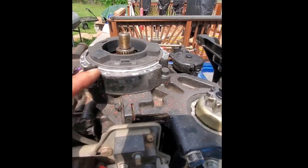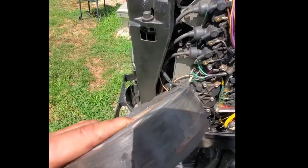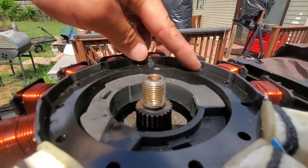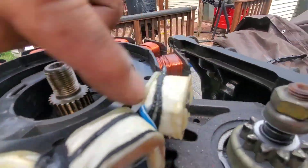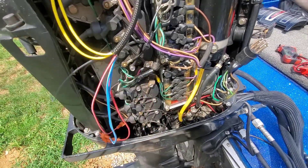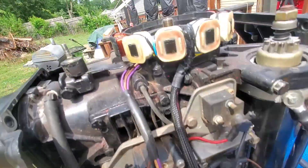Let's get the new stator in there. Now I've got the new stator in place, and the positioning is important — the harness needs to be facing the switchboxes, right above them, and then you need to line it up with the holes. I was actually able to find another stator screw in my inventory. I'll put some thread locker on them and lock this down as tight as I can, because I don't want it to slide and disconnect again and cause a bunch of headaches. Then we're going to connect the two yellow wires — these go to your rectifier to charge the battery. The red and blue wires with the stripe go to the top switchbox, the solid ones go to the bottom, and the black goes to your ground.